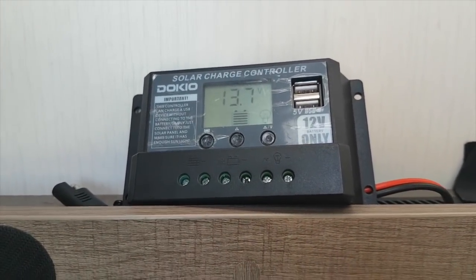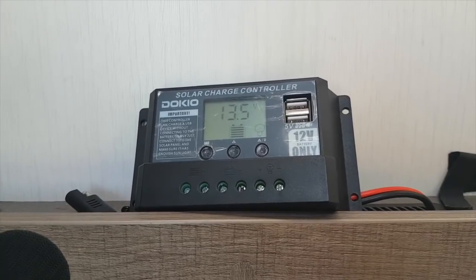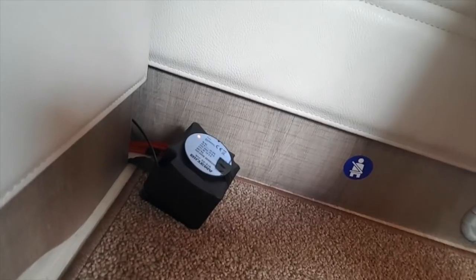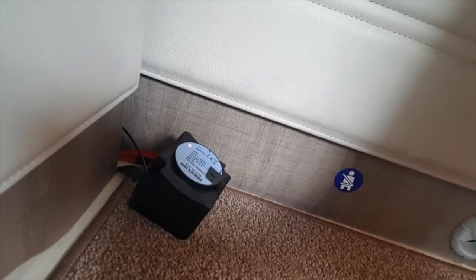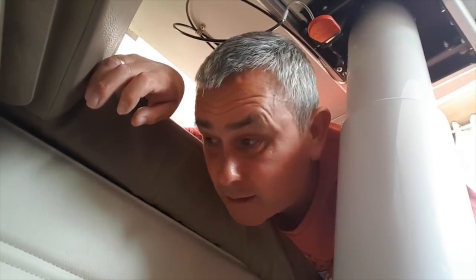My name is Smiley Miley, I'm out of here! Let me show you something — there he is. He now has a little pacemaker fitted which, after a couple of days, is doing exactly what I wanted. It cuts in on 13.3 volts and cuts out on 12.8 volts. It's got to stay there because they didn't have enough cable, but no one puts their feet there in this van, so it's no big deal. It'll keep us going — which is bloody marvelous!